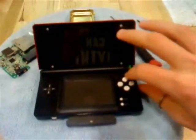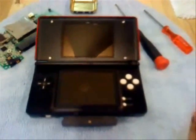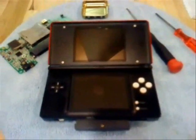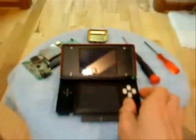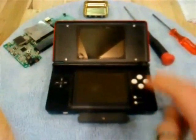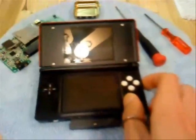There's a couple things you can do. Fail-safe code is written into your DS firmware at the time when FlashMe is installed. It's located in the first few blocks of firmware that you install with FlashMe. And in case something gets corrupted, you can usually do Start+Select and power on to get to your flash card menu. This doesn't always work — it only works sometimes. The point is, it just doesn't work very well.